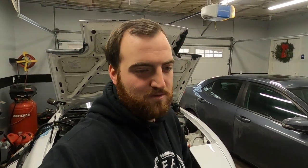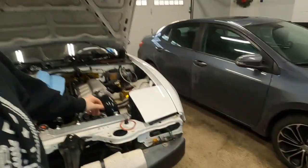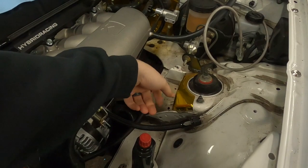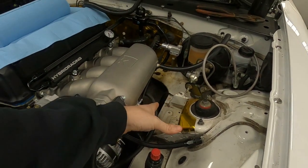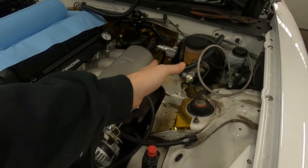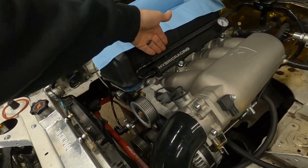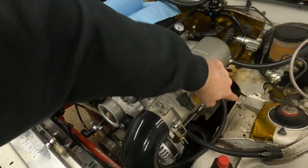I'll probably package that up this week and get it out the door. It's about a two-week turnaround, so the sooner I get it to him the sooner I get it back. Then we will be building a catch can — maybe a catch box cut out of some flat plate, welded up together. I'll run from the ports side by side and then out into the can. I might just end up running breathers on the catch can for simplicity's sake. Should be more than enough.